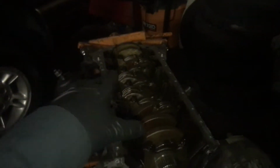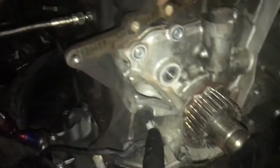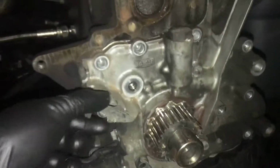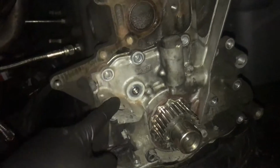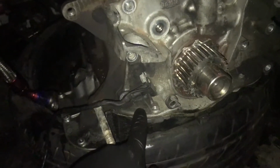My dumbass, on the other hand. So last time, I put the oil, or the sump, technically the housing for the sump, and then the oil pan, on the 2J, thinking it was gonna be fine. But then I find out that the 2JZ GE, which is the block I'm using, doesn't have the crank position sensor that the GTE and the 1JZ have. So that's where I messed up, and the only way to take it off is to have the sump off, because there's a little bit of a lip on it.